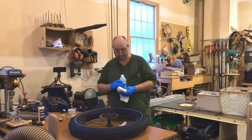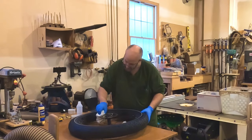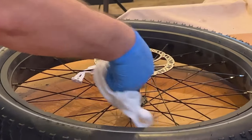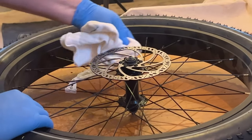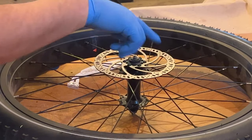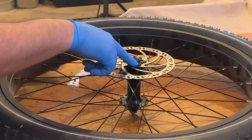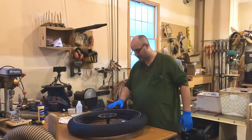Before I put it on the bike, I'm going to use a little isopropyl alcohol and wipe down the surfaces where the brake pads will go — front and back — just to make sure I don't have any oils or dirt or debris from the process of putting this on. Another thing I'd like to point out: don't ever use grease or oils on the bolts. As the brake rotors heat up and dissipate heat, oil on the bolts can come out and contaminate your surface. So don't use any grease or anything on your bolts for the brake system.